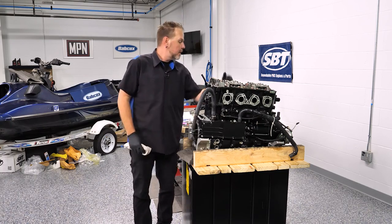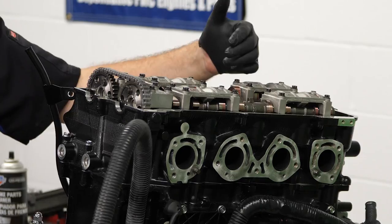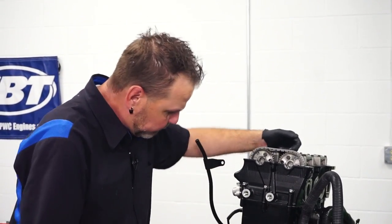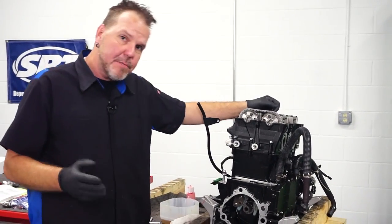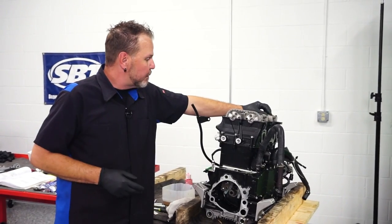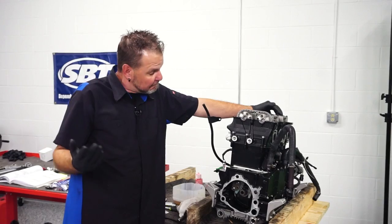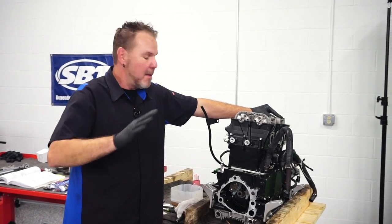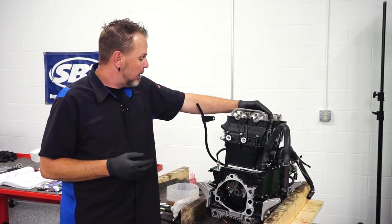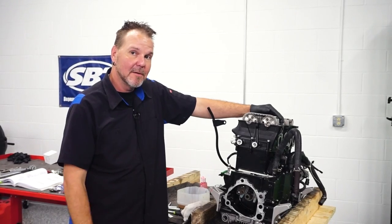All right, we've made two revolutions from back here counterclockwise to make sure that the timing marks would line back up where they're supposed to. And after two complete revolutions, my intake and my exhaust cams are right on the money. At this point, what I can do is start torquing all my caps, as I didn't torque them in place before, and finishing tightening up anything else that was loose up here. I like to leave it just a little snug when I do these in case I need to make any adjustments. I got lucky on the first try — sometimes it might take a little bit of work to get it perfect, but we're good. We're in time on this engine right now. We're in the home stretch of this build now. Once I torque this down, basically time to bolt the rest of it back on and get it back in the ski. Thanks for watching. Bye.